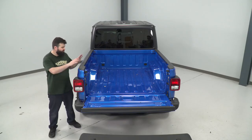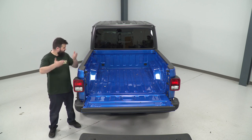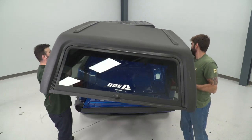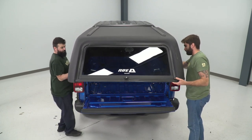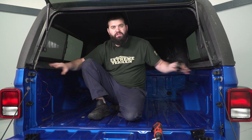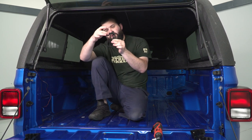Now's the time we're going to take our cap and put it onto the vehicle. I've got an extra set of hands — I highly advise you to do the same. We're going to go ahead and lift it and just place it down lightly. Now that we've got our cap on our vehicle, we centered ours. Now that it's centered, it's time to put our clamps on. They're going to go just like this — this is going to go underneath, this will be on top, and it's a 14-millimeter bolt on top. I'm going to go ahead and start installing these now.